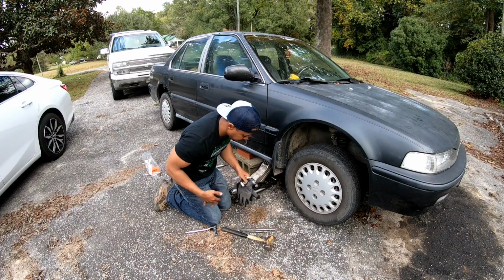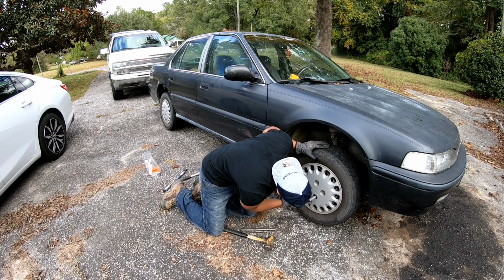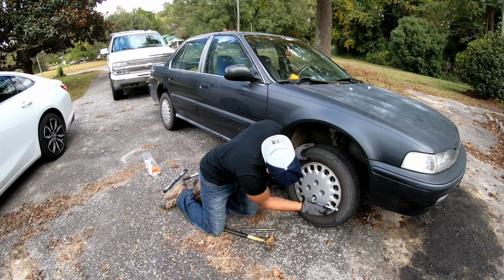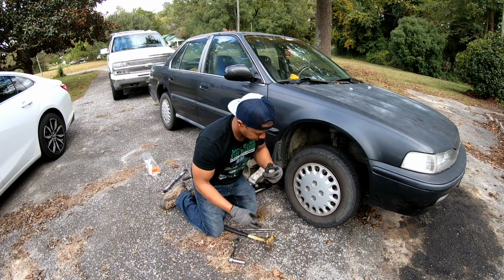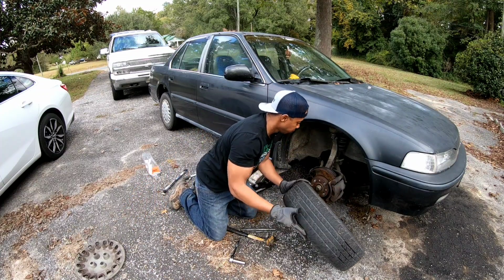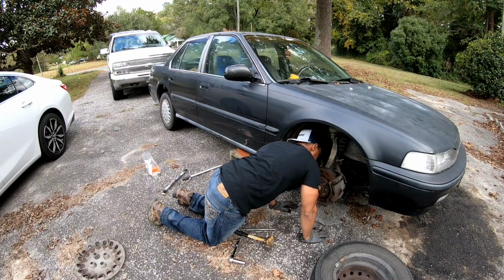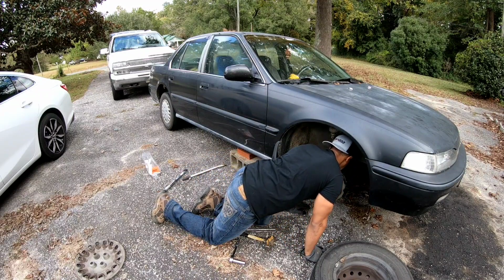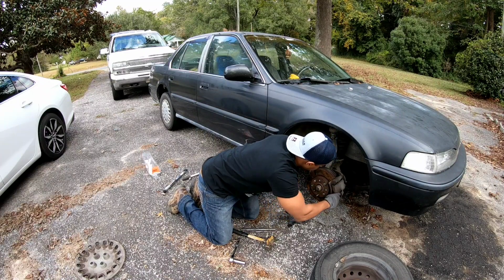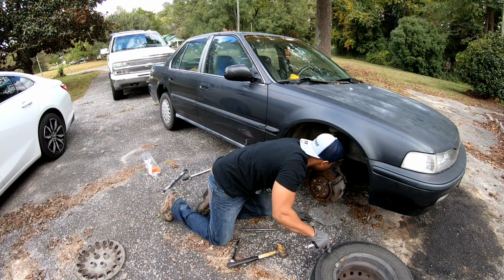Okay, let's see here. I'm gonna take off this one lug nut. Yeah, it needs a new piece on it there anyway. Hubcap. Lay that over there. Yeah, I'm wondering, you guys, if I'm gonna have to turn that wheel to see in there better. But anyway, you gotta take off this entire brake caliper, and it's supposed to be a 17. I got a wrench here. I don't know if I can get a socket back there or not.